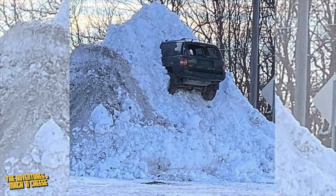I wanted to make sure that I had a way to tow my car from the back. So if I got a hitch receiver, I found out, basically it'll be good enough because the forces are not that great. As long as I'm not stuck in a snowbank or rolled over in a ditch, it won't be that bad, and it'll be easy for a tow truck driver to be able to use that point to winch my car up onto a flatbed truck to tow it to a dealer.